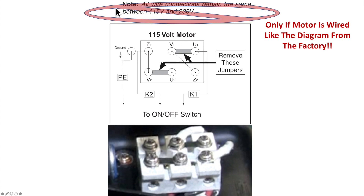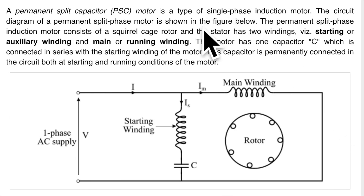So you can't follow the instruction that says 'all wire connections remain the same.' That only works if the motor comes wired from the factory correctly and if you put the wires in the right place for K1 and K2. On a side note, when I first called Grizzly, they talked about a set of points being inside this motor — a centrifugal switch — but this motor does not have that. This is what's called a permanent split capacitor induction motor. It uses the same start and run capacitor, just has its own start winding inside, and I'm pretty sure that is what I smoked. Since I still had a primary and secondary winding, I could still get an ohm reading through those. I took it all apart thinking maybe I could put in a new set of points or fix something, but that's not the case — I had pieces of copper falling out. I'm pretty sure it was the start winding that I smoked out on both of these motors.